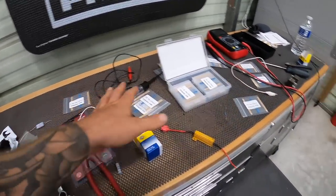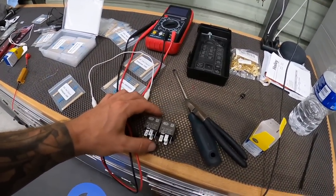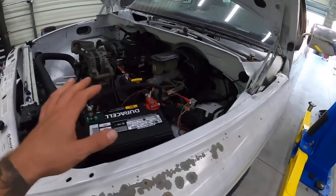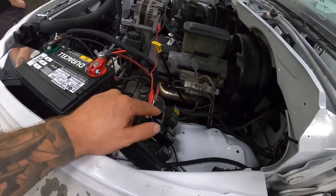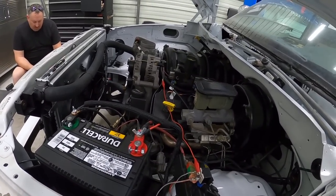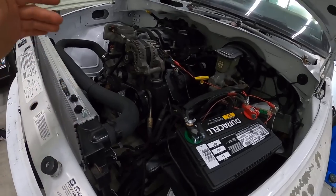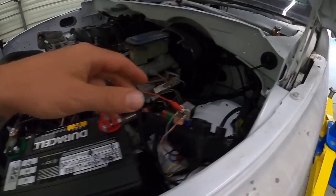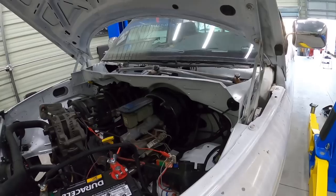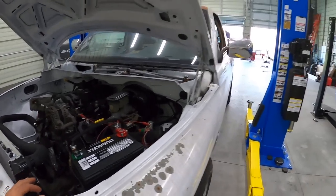Me and Dennis have been playing with resistors and all sorts of electrical stuff trying to figure out the pinout on these relays. We ordered a second relay from Amazon and went back and forth. We ended up going with a conventional relay, turned down the frequency, turned up the duty cycle, and we seem to be getting at least enough voltage to be charging. What I want to do now is heat cycle the truck — back it up, let it run, watch the fans come on, and let the Holley EFI do some self-learning.